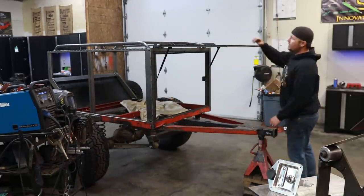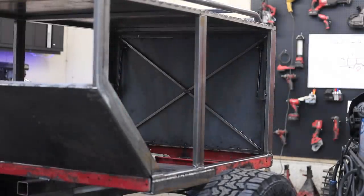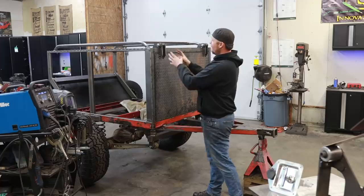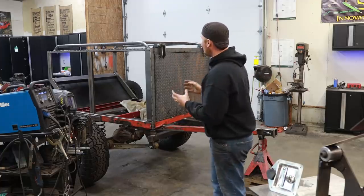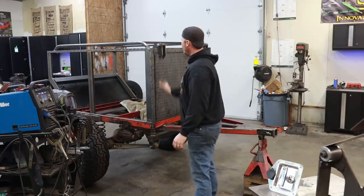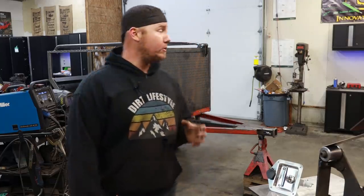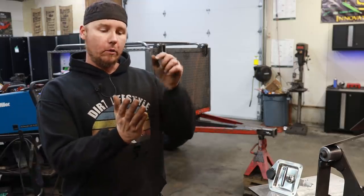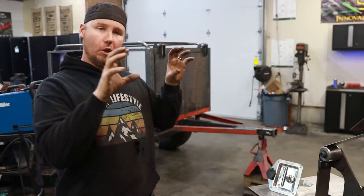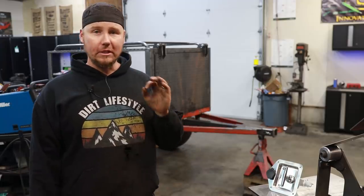Let's talk about these hinges — I think they're going to turn out really good. Right now they're just kind of scabbed on there, I have everything tacked, but it's a bunch of heavy-duty tacks. It's kind of amazing they're holding up because right now there's technically 150 pounds of force going right up on the hinge. But we're going to box those in top and bottom, they're going to be super beefy when we're done. We're going to drill holes through the skin and weld backing plates on the backside, then weld those backing plates into the frame of the door. So these hinges are going to turn out perfect.